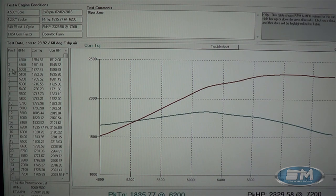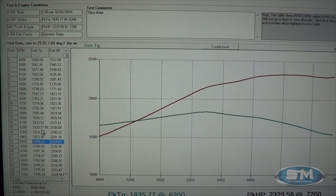As you can see here, at 5,000 RPM we are at 1,677 foot pounds of torque and 1,590 horsepower. At 5,500 we are at 1,747 torque and 1,823 horsepower. At 6,000 RPM we are at 1,820 torque and 2,070 horsepower. At 6,500 we are at 1,800 foot pounds of torque and 2,218 horsepower. It did make peak torque right there — that's just because of the way we're manipulating the boost curve right now, but we could change where that's at.